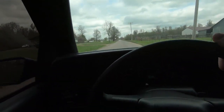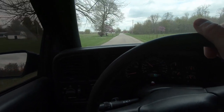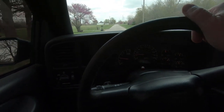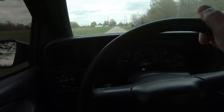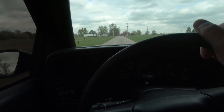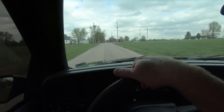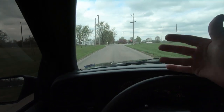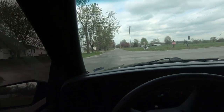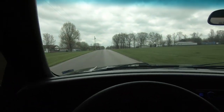Two more of these and we will be set. One more and then we need to drive around for 5 minutes trying not to touch the brakes — just kind of roll up to a stop sign if you have any. The best way to do this is out in the middle of nowhere, or you can manually shift your vehicle down into first gear. That's what I did in my wife's Cadillac — it has paddles on the steering wheel. Now we'll drive for 5 minutes and then once we get back to the house, I'll let you guys know how it went.